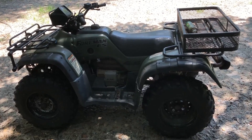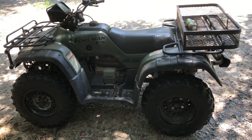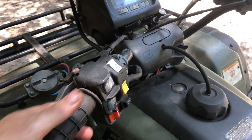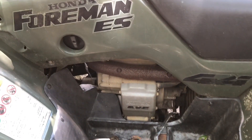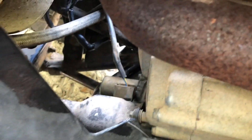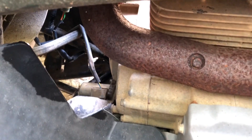What we have here is a 2000 Honda Foreman electronic shift — this is a 450 ES. If you're like me, you get sick and tired of chasing gremlins: you go to shift and nothing happens, you have to get your manual shift tool and put it on. What we're going to do is make this permanently manual shift so I quit having to worry about losing that tool. We need to get down in here and get that shift motor, get underneath, pull it out and gut it so we're not fighting it every time we try to do the manual shift.